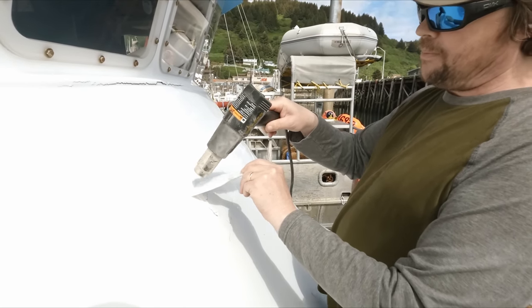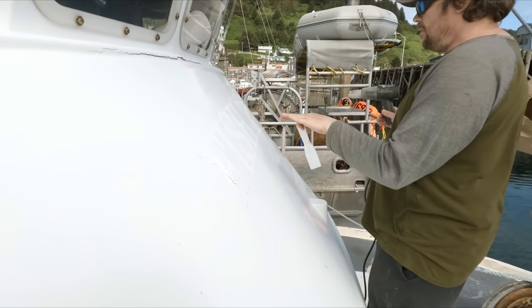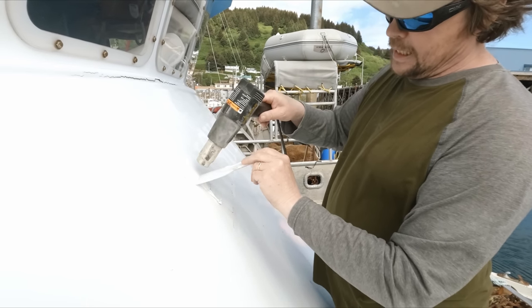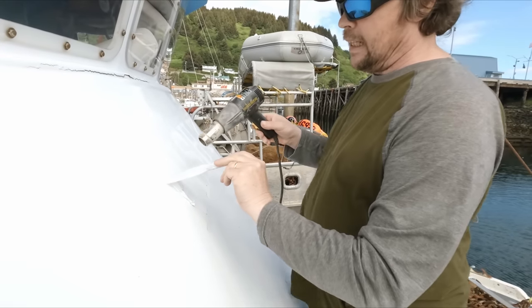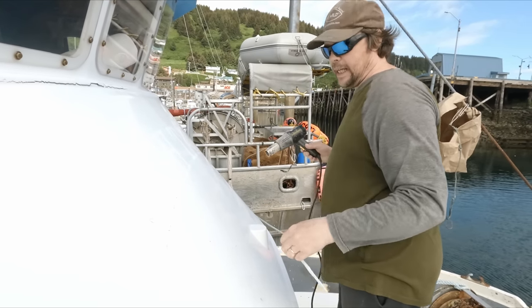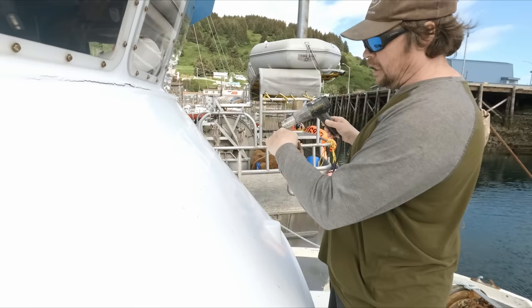You actually have to plan this out in advance. Get yourself some butcher paper or parchment paper, put it up here, and figure out what kind of curve you want — whether you want it straight or a little bit of a curve. Lay that out on your paper, then lay it flat on a table and figure out the difference between your curve length. Then lay it out in whatever cutting program you're using. Basically, you just make an oval with that depth of curve and that length.